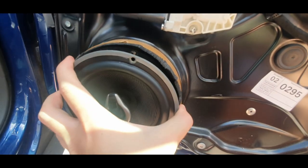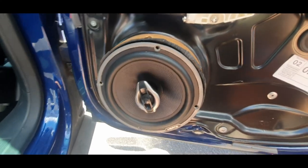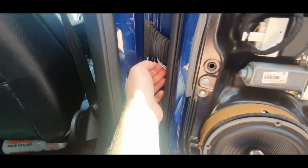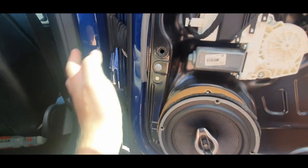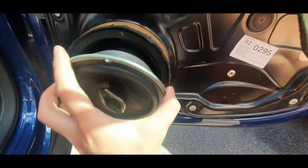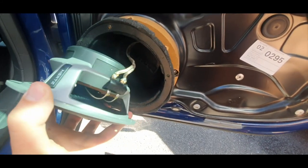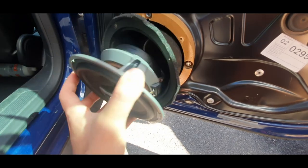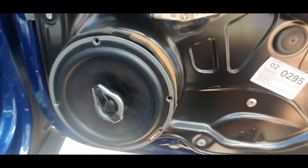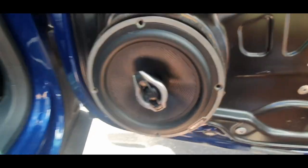So there are the three main things I can suggest as to why your speaker isn't working: no power from the amp or head unit; the wires at the door hinge might be broken from opening and closing the door; or if you press the cone in and out and it sounds crusty, it's blown because the coil has packed up. I hope that helps. If you want to carry on watching I'm just going to go through and make a hole in the baffle. If not, please like and subscribe and keep watching my other videos — there are loads of car ones on there.